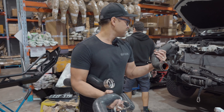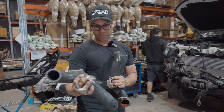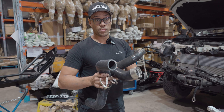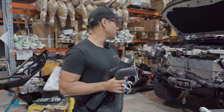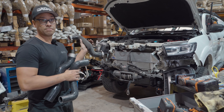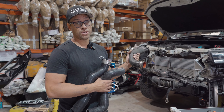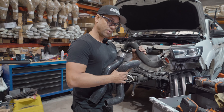While the car's here, the customer also wanted an intercooler upgrade and a hose upgrade. We're going to put upgraded hoses on — much stronger and much more durable. A lot of these factory hoses have been exploding, so you can order these at savagetech.com.au. We're also going to do some testing on the dyno to make sure everything's good. This car is already running a stage one ECU tune from us, so it makes decent power. The customer loves to do towing, so he'll feed back information on how it performs when towing with the new intercooler, because these get a lot of heat soak when towing up big mountains.